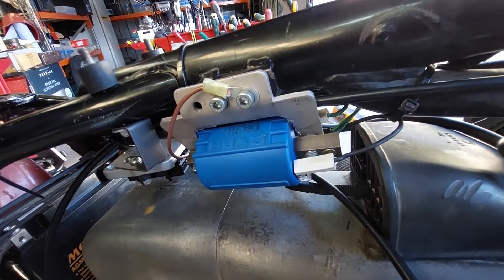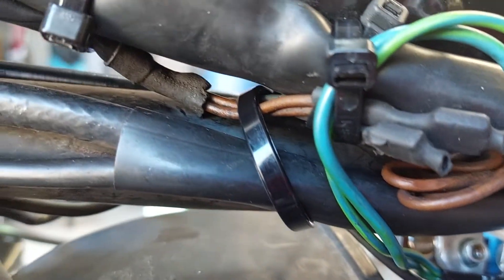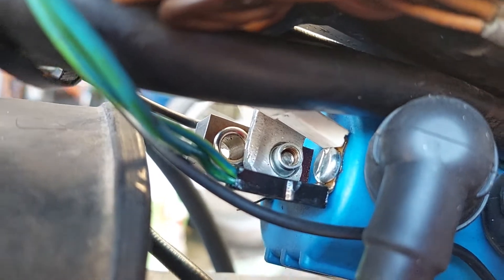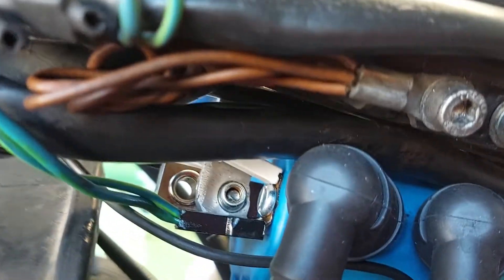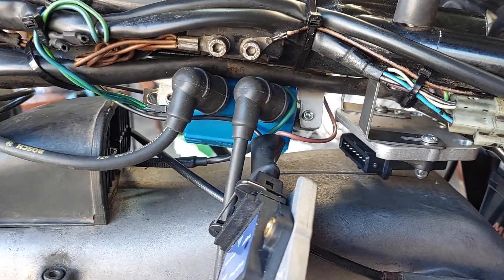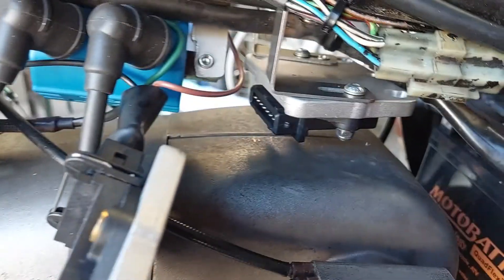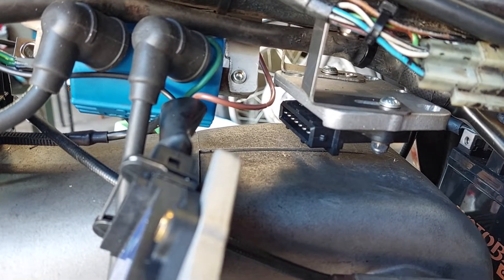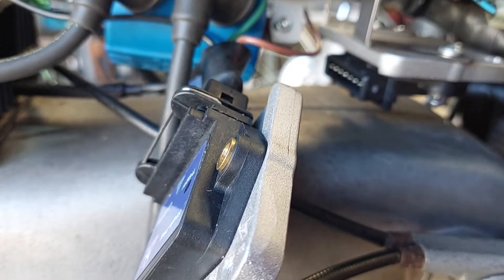That is essential if you're going to run these systems — they must have good electrical contact. You can see the black wire hooked up on this side. Going around the bike you can actually see up in there the green and blue wire on one bracket, and the green wire going back to the module on the top bracket, the earth wire on the other side and the black wire on the other side — so that's your trigger and your coil installation from this side. You'll notice that I've now plugged another module in here that is designed so that I can show you how to time it. The module will work because it's the cabling that's earthed, not the actual module itself — it draws its power, earth, and triggering all from that little cable that plugs onto it.